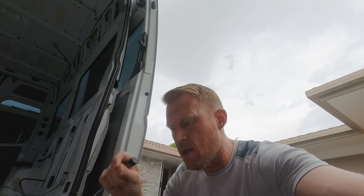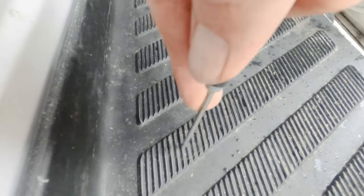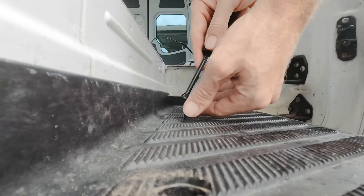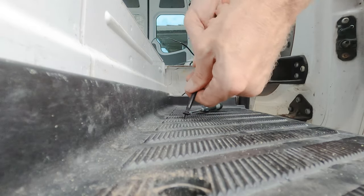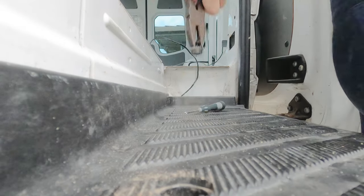These little plastic clips were pretty difficult to get out — I hacked at the side with a flat screwdriver. I saw online that you drill a self-tapping screw into the top and pull it out. What I've done is pushed a screw through the top, created a little hole, and then pulled them out with it. It does cause a little bit of damage — I assume Mercedes would just replace these every time. So I'm just going to do the last one now: push down through here and screw through the top, then grab a pair of pliers and pull straight up.